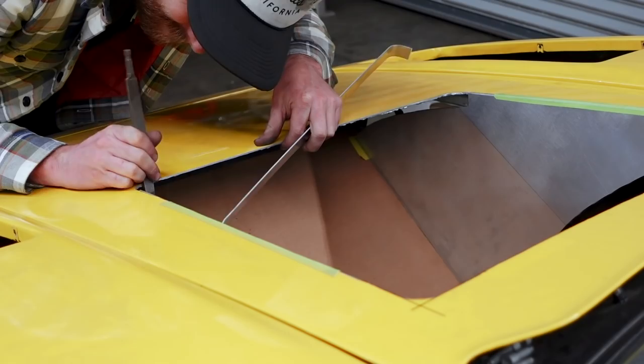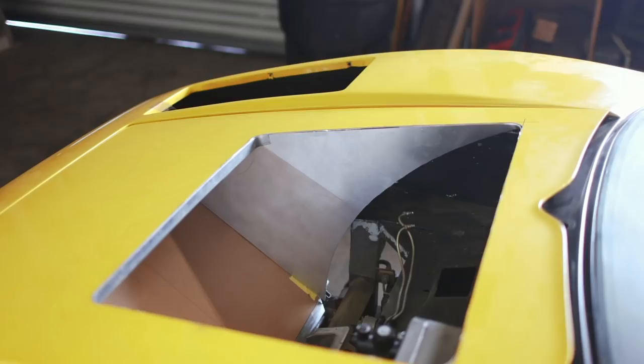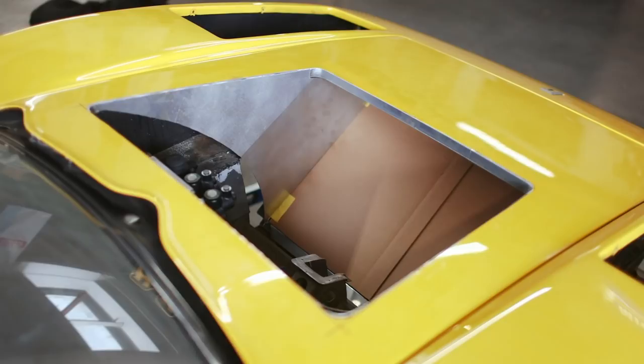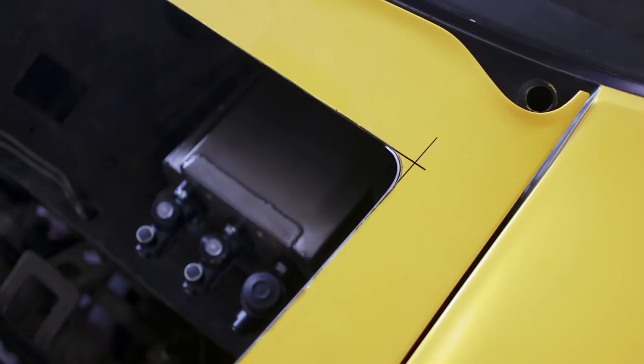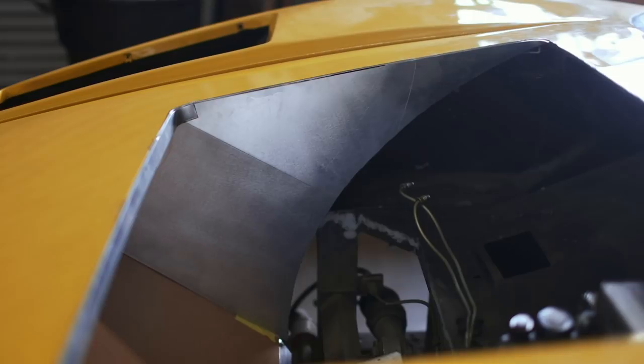Because this entire duct is going to be welded to the hood, I have to make sure the fit-up of the parts is as good as possible — you can't weld too much of a gap when it comes to aluminum, and I want the fit and finish to be as OEM as possible. We've only got two panels left to make at this point, the front and the back, and the fit-up of our sides is looking pretty good. Our curved corners all line up with the panel really nicely, and all these parts fit up with just a little bit of tape holding them in place, which is a really good sign. However, I ran out of material big enough to do the rear piece, so it looks like I need to go get a full sheet. We'll save that one for later this week or next.